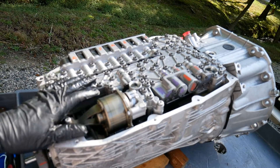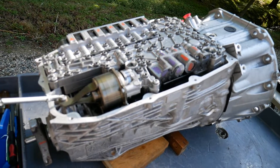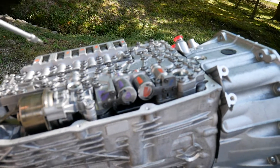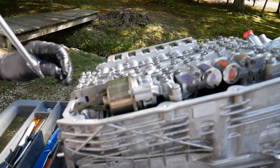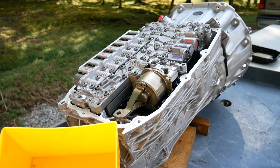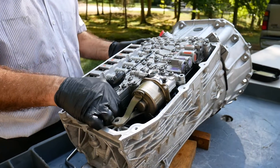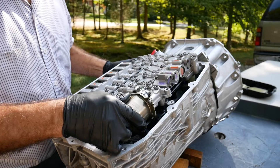We'll cover the valve body in depth in a separate video. To remove the valve body and transmission control unit, only the T30 aluminum bolts need to be removed — they're obvious compared to the conventional steel bolts in the aluminum valve body. Only one bolt is a different length: the short one holding the bracket for the brushless DC motor. All others are the same length. After removing 15 aluminum bolts retaining the valve body to the magnesium-aluminum transmission case, it simply lifts off — coax it a little at the electrical connector, as there'll be some resistance at the pump.